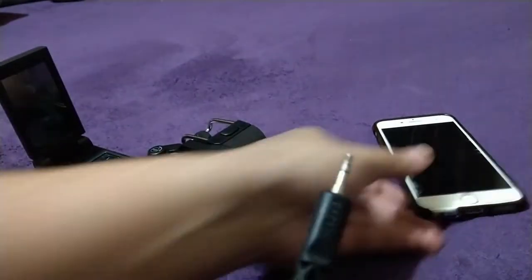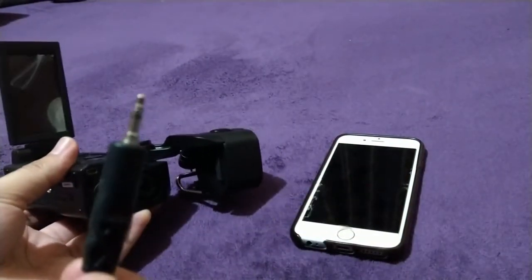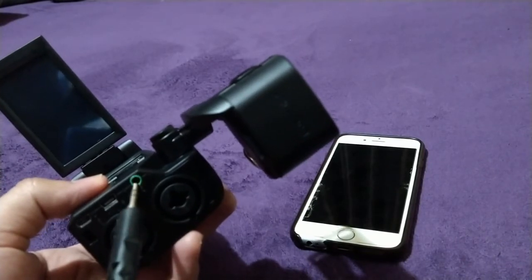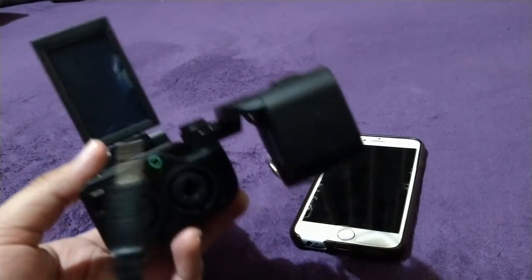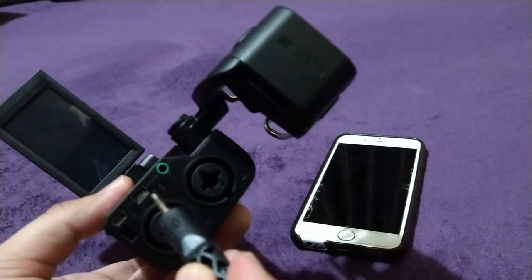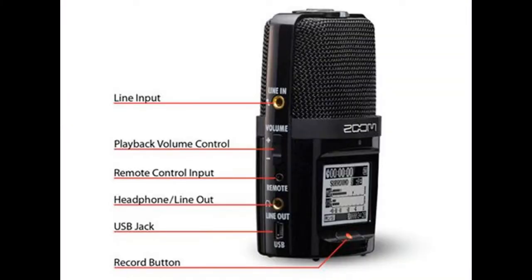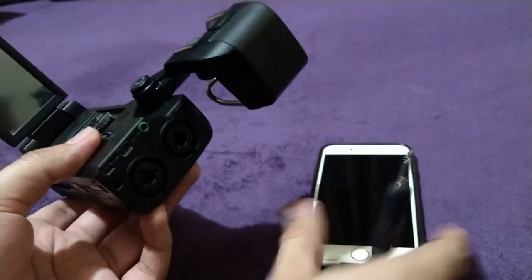You would connect one end of the aux cord to your phone, like we've been doing. Then the other end would go into another port on the recorder — not the headphone port. You do not want to plug it into the headphone port because that's going to mess up your device. What they would have instead is a port that looks like this, and it's going to be called a line-in connection. You would connect your phone into that line-in port, and it would capture the audio from your phone into your sound recorder the same way.